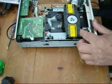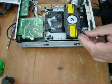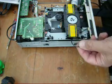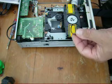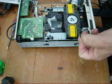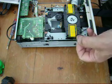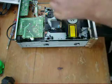Right, it needs to be a square belt. I forgot to mention that, not a round belt. The belt is actually square in section, so you're looking for a 25mm diameter, 2mm thick rubber band, if you can get it, and it's 85mm internal circumference. You could use a 79mm, it would be just a little bit tighter, would probably work for longer.